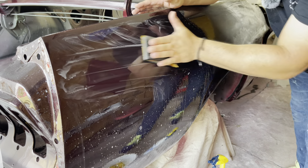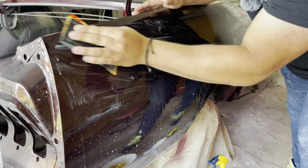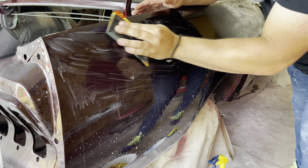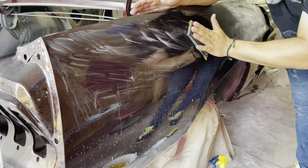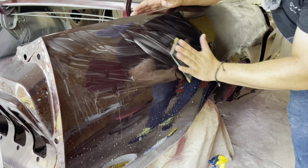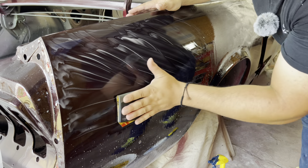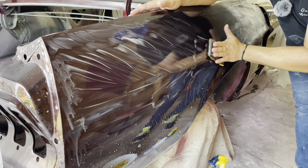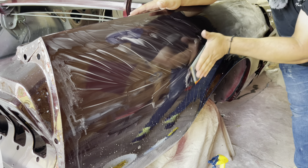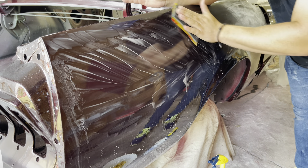The white residue is the clear coat you're sanding away. Let the sandpaper do the work — you're gonna feel right away where it's sanding versus where it's gliding. When it feels like it's gliding, that's a spot you've already knocked down. Make sure you have enough clear coat. I learned my lesson: never less than three coats of clear coat, and be generous on that last coat for this exact reason — so you can sand and cut it.